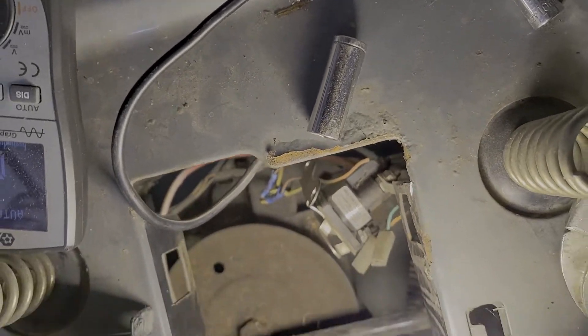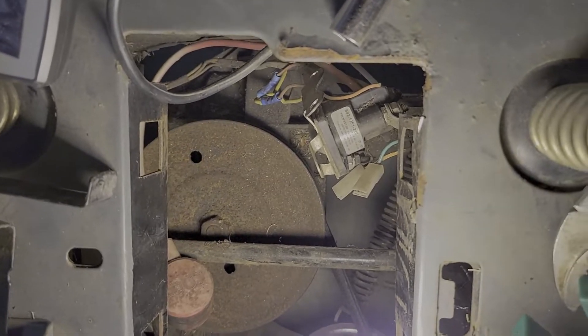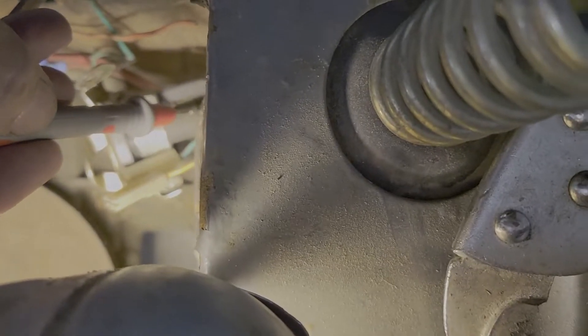Only change the solenoid if it's what's bad. I've got one end of the meter tied to the starter cable, and I'm getting continuity back to the solenoid on the 12-volt side — continuity from the solenoid over to the starter. And I'm seeing one major problem right there. It looks like it's making a connection, but a pretty poor one.